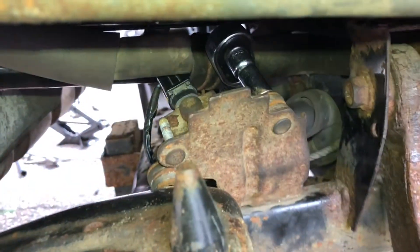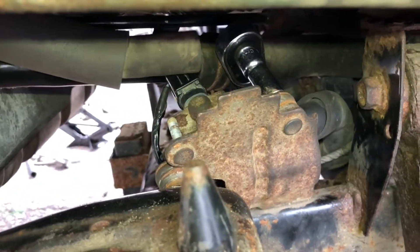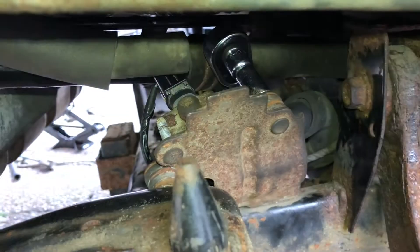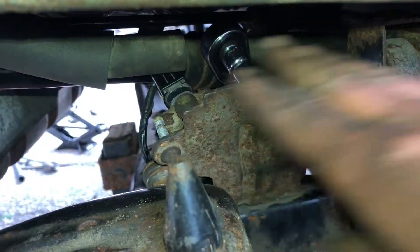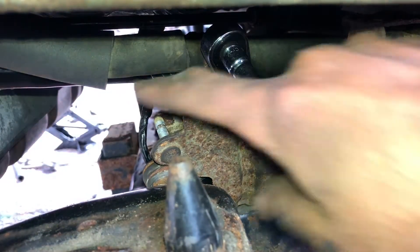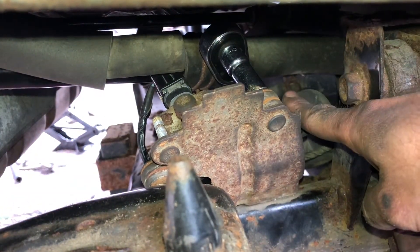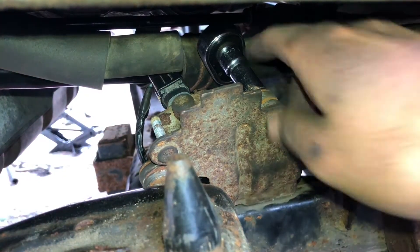Well over three inches dropped and that gives us tool access for a 10 millimeter six-pointed socket on both. We got one off — the nut was rusted but it wasn't seized, thank goodness. We got this 10 millimeter off and cocked it gently to get the next 10 millimeter off. Then we'll take the connector off and then take the canister side hose clamp off once we have better access.